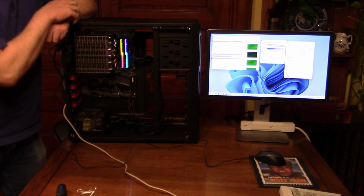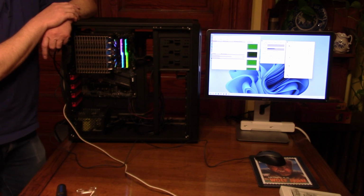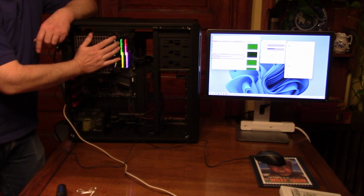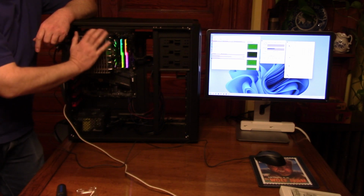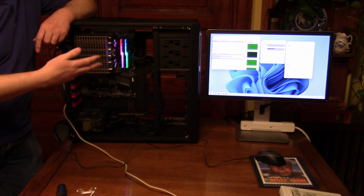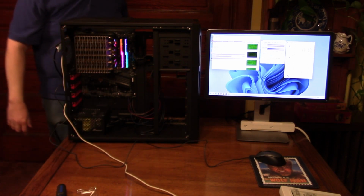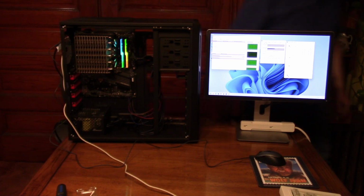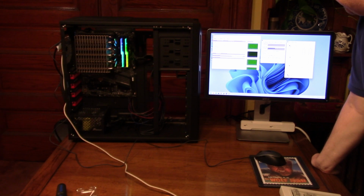It'd be interesting to know, and I guess we'll run this test for a while. It'll be a long, boring video, guys, if you want to hang out. But it'll be interesting to see, once the aluminum gets hot, how long is it going to take for the CPU to get cooler? Or will it reach equilibrium before the thing gets hot, since it's only that 65 watt processor? It's almost to 60 degrees.